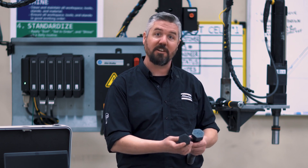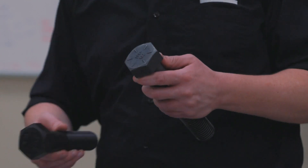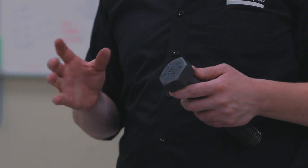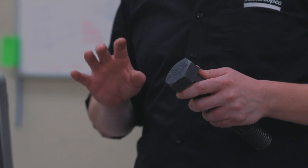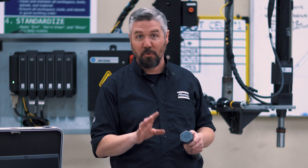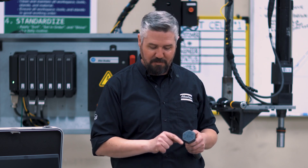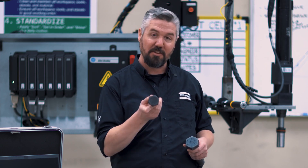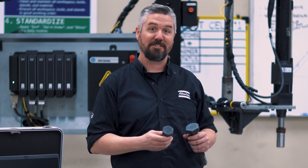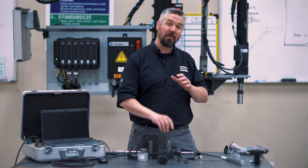It's going to have a metric thread pitch, and you should go get your metric socket set if you want to loosen or tighten that bolt. If it has dash marks like this bolt — there's six dash marks on here — the formula for an English or SAE bolt is: number of dash marks plus two tells us the grade of the bolt. Six plus two is eight, so this is a grade eight bolt. This bolt has three dash marks; three plus two is five — grade five bolt. Leave it to the English system to do something way out of the ordinary.